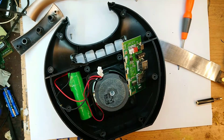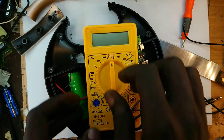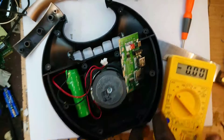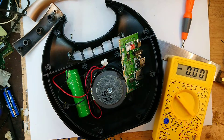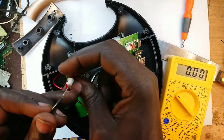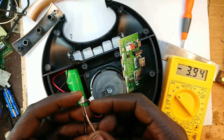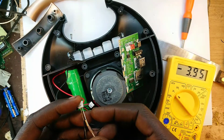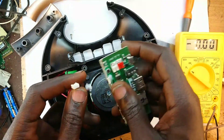We will need to measure the voltage across the battery to see that it is sufficient for it to be detected. We'll do that with the electric power meter — place it in voltage mode, bring the probes, push in one probe followed by the next. We get 3.9 volts, so this is close to fully charged. I believe we might be having another issue.